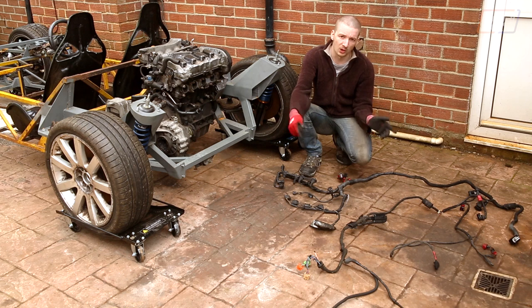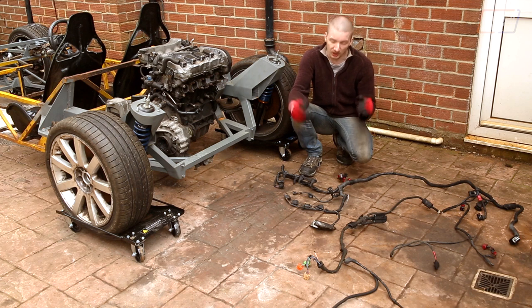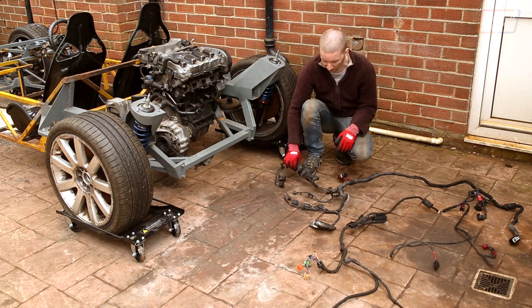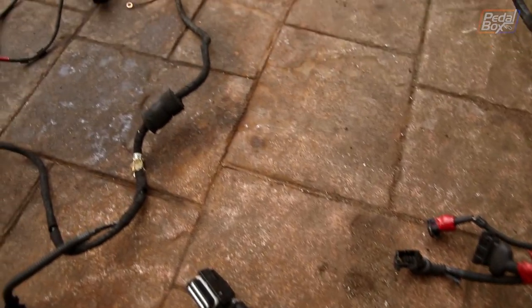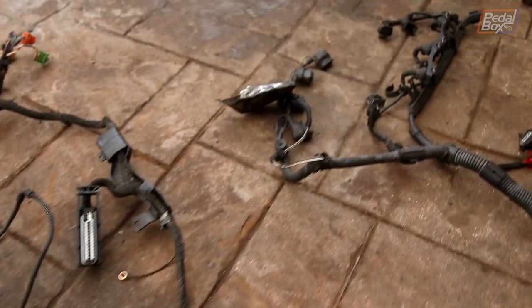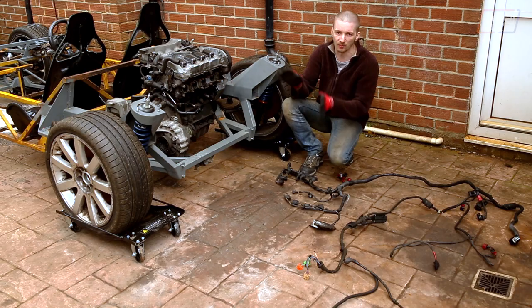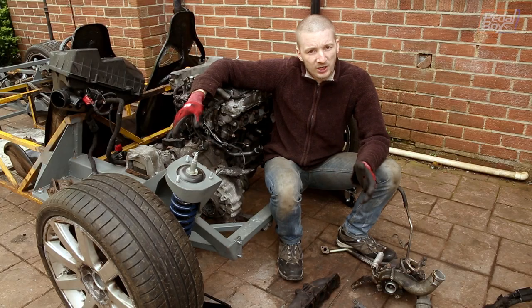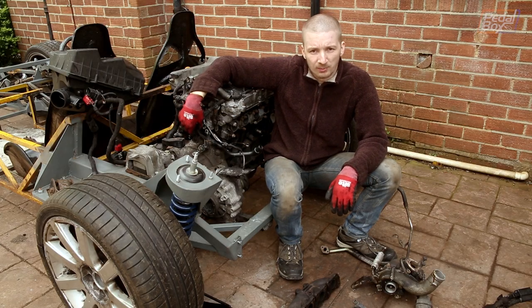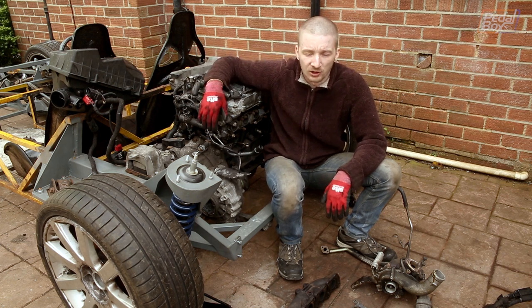What I've got in front of me is one of our two wiring looms. We've got the big main car loom that does lights and comfort stuff, but here we've got some of the engine looms — things like our fuel injectors, coil-on-plug triggers, and a couple of little sensor connectors and gubbins like that for the ECU. We're going to get some of this hooked up onto the engine and see what sort of sensors we need to dig out, see what connectors we need to find, and see what we need to get this vaguely near a point where we might be able to turn the key and start it. We've got the engine loom in, mostly all plumbed up to everything it plugs onto, but we do have a couple of open questions — a few two- and three-pin connectors scattered around that we need to plug into stuff.